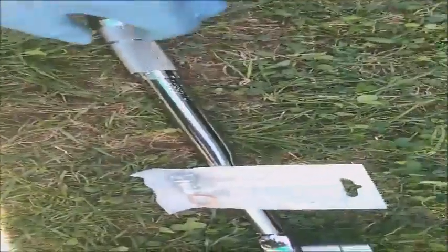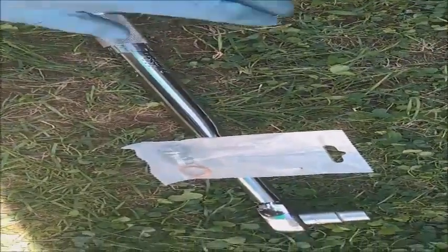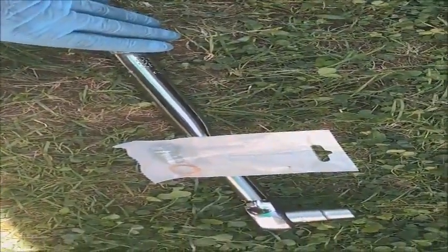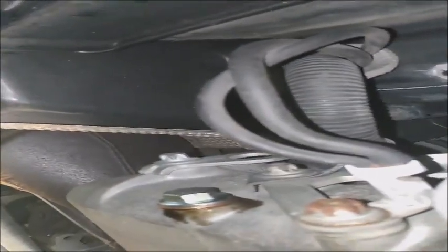So now the drain plug is also 25 Newton meters. This is the torque designated for it. So it's set up the same as the oil filter. Just prepare this and go in. Again, I put it in manually. The new drain plug, I put it in manually until it's tight. Now I'm going to torque it with the wrench, and this will finish the job beneath the car.